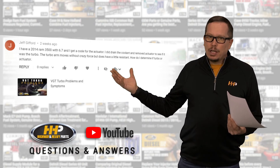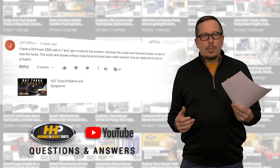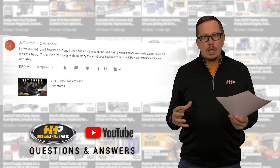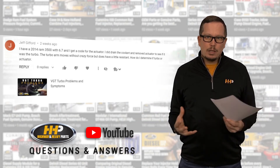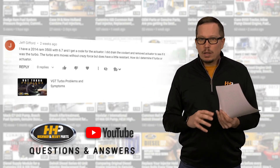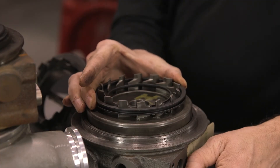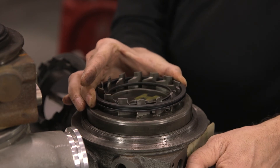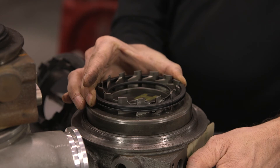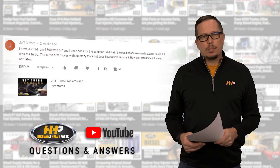You might not see that in your tailpipe with today's engines — DPF filters and such catch that. But the turbo is the first thing it sees before it gets cleaned. So carbon can build up inside your turbo. Sometimes it's as simple as pulling the exhaust housing off and cleaning the carbon out, getting it free, making it run smooth. If it's not bent, damaged, or broken, just a cleaning can get that thing back together. Ultimately you want to find out: is it electrical or is it mechanical? Then get to the root cause.